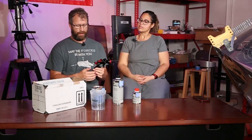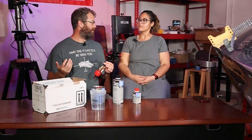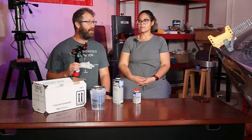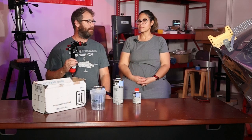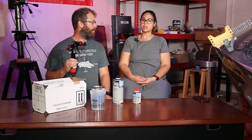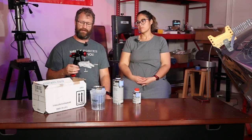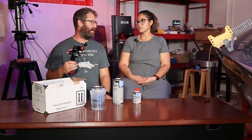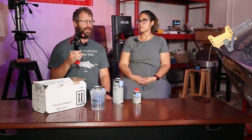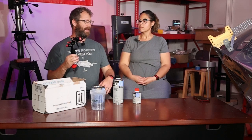So, you know, Harbor Freight is half of our build. We went to Harbor Freight, and you can get the $13 gun. And a lot of people have had good luck with a really cheap gun from Harbor Freight, mainly for priming. Okay. All the resources that I've seen online that I've been using to educate myself on painting say cheap gun for priming, and even if you have a nicer gun, save a cheap gun for all your priming and use this for your base coats and your clear coats.